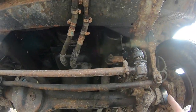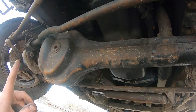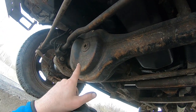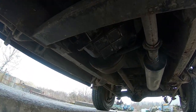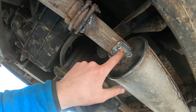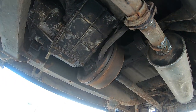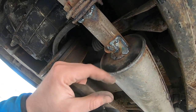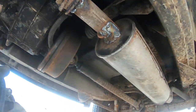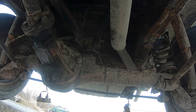Steering box is leaking, obviously. Luckily those seem to be dry. Need to check if there is whole oil in the diff. Did some quick patch up job here. It was making pretty nasty sounds. I just wanted to listen to the engine better, so that's why I welded it. I will obviously make a new exhaust for this thing when I'm done with the frame and bodywork.